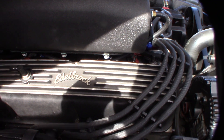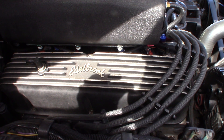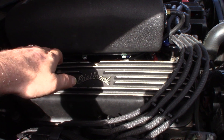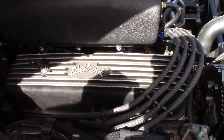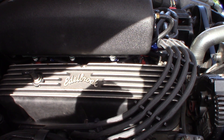There's no anti-drain back valve or check valve. What happens is when I turn the car off, the fuel rail loses pressure, and on a hot day the fuel will boil on the rail and push the fuel back through the pump.